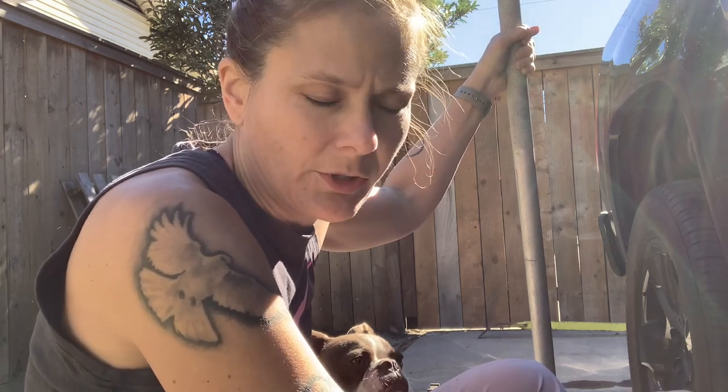Usually when you jack a truck up, it's a good idea to put the emergency brake on, but not when you're changing the drums, because the emergency brake is hooked to the drums and you won't be able to remove it with the brake on. So make sure your emergency brake is disengaged.